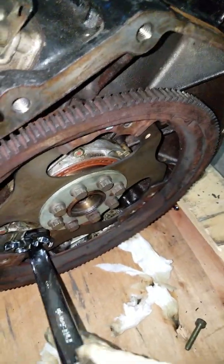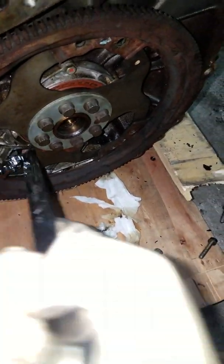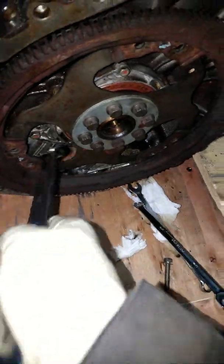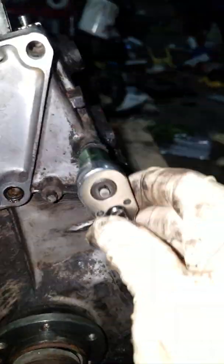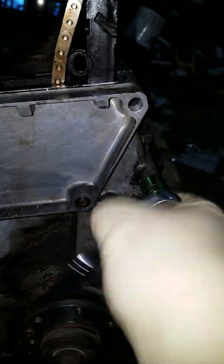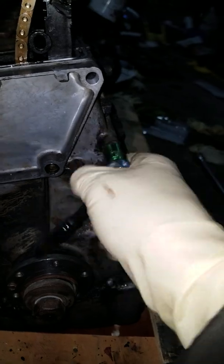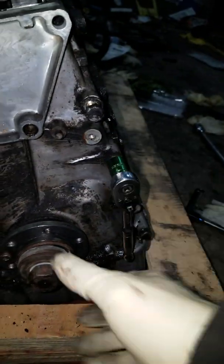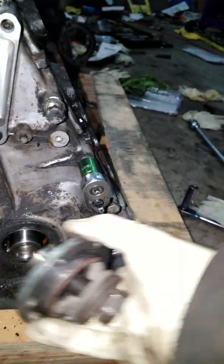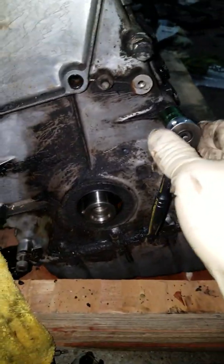Make sure to always drop a little bit of oil around your pistons. Alright, so we are going to proceed to take this front timing cover off all the way. This just pulled off — apparently there is supposed to be a removal tool to do it, but I just pulled it off.